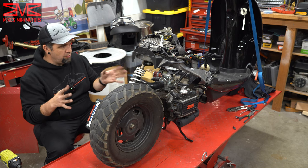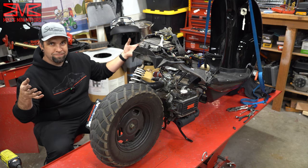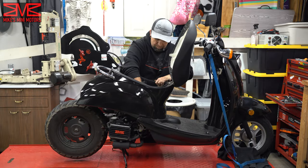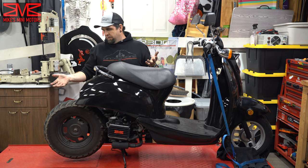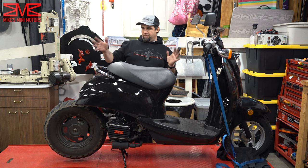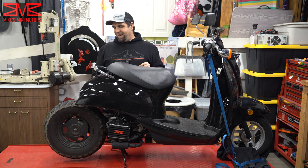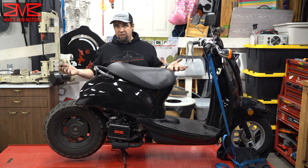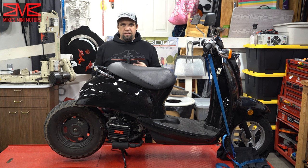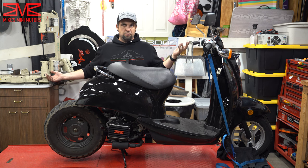There you have it — got the stretch kit all installed, everything bolted back together. I even started it up for a second just to make sure everything's good. Just bolting the plastics back on and we're done. It looks a bit better with the more stretch. I'm definitely going to have to get a low-down shock — it looks quite a bit high. It is on the center stand still and I'll see when I get it off, but I'll probably want to lower this thing a bit more. And I need to clean this thing — the engine was filthy. So that's the Small Fast Things stretch kit. It was pretty simple, straightforward install. There were a couple of things like grinding the shock mount a little bit, but other than that it was an easy install. I'll put a link in the description if you guys want to pick that up.